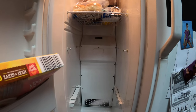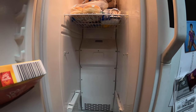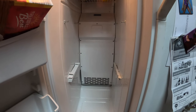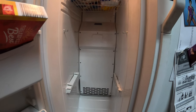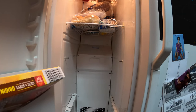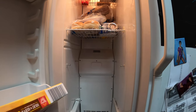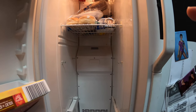There's a fan on those coils. If that fan is not working — which happened to be my problem in this case — the cold air is not gonna be pulled or blown through the coils very well. Your coils are probably going to freeze up, which in my case they were frozen, even with the defrost, because the fan wasn't running pulling the air through them. Now, was it because the fan was bad? No, turns out the fan wasn't bad. There was a switch on there that went bad. So we're gonna pull this out and show you what we got going on.